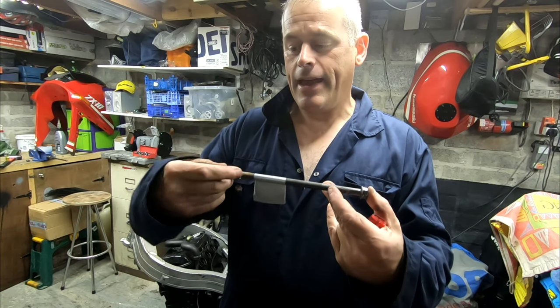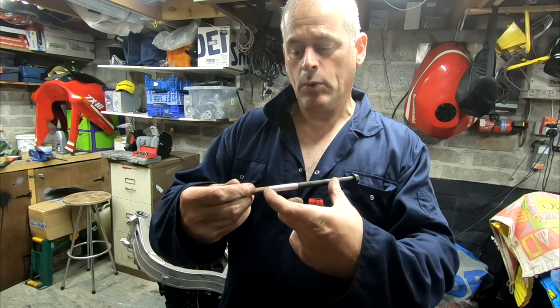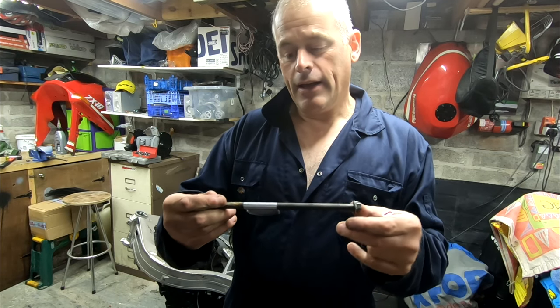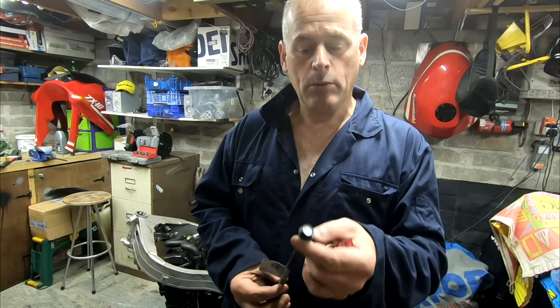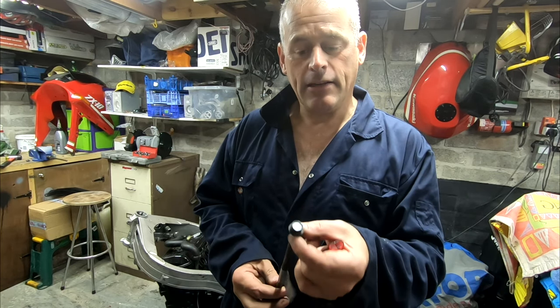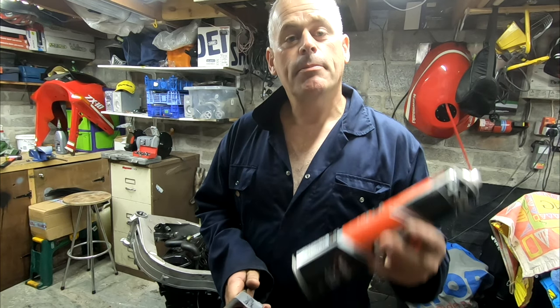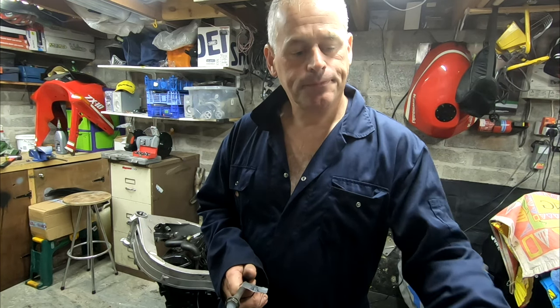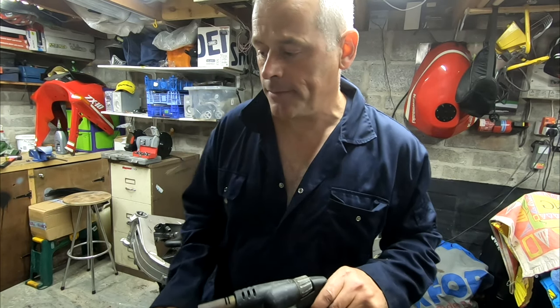Now it's held in there and there, where it hooks into the frame and the engine, and then you've got an exposed part here. On the last bolt, you can see a lot of rust here. The head of the bolt is all chewed up, so it looks like somebody's had trouble in the past getting it out. So I put some penetrating oil on the bolt, and I'm going to try heating it up with a blow lamp and see how that works.